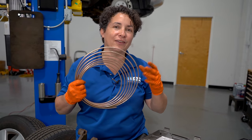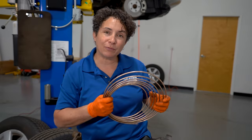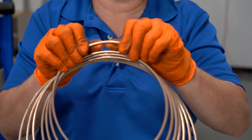These are the type of brake lines that come now aftermarket — instead of those stiff steel lines. If you've ever had to bend one, it just aggravates you. This is amazing; when this product came out I was beyond joyful. No more excuses for not doing brake lines the correct way. This is a 3/16th line — you can bend it easily and go around a corner. Just keep it away from moving parts, make sure it's fastened down, and don't leave it vibrating or rubbing against metal. I see people leave them flapping around all the time — that's a mistake.